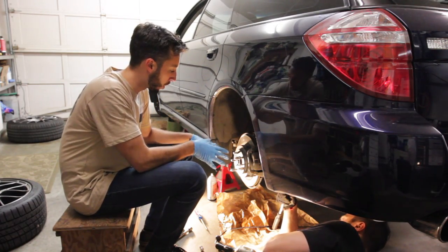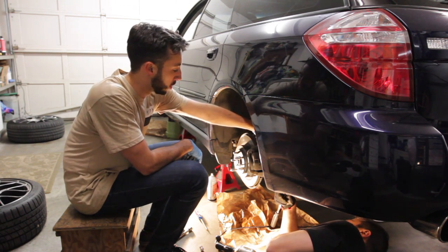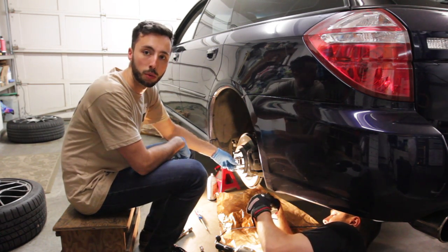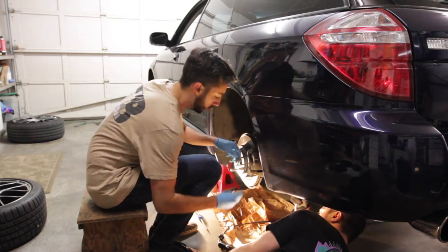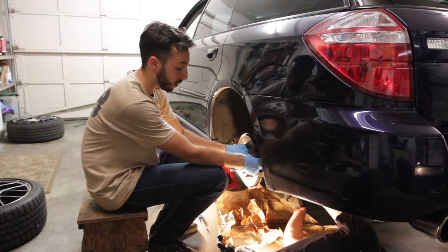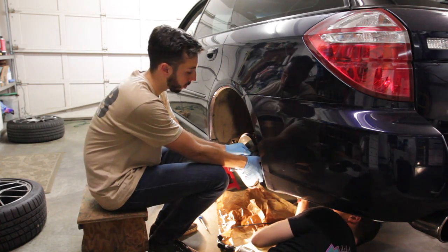We are on the last rear rotor. We're going to go ahead and break these caliper bolts loose. Lewis already got most of them off, so we're going to pull that off and show how to get the back rotor off once the caliper is released. Once the bolts are off — same trick as the front — you can poke a screwdriver in through the caliper to press those pads back and release them from the rotor.